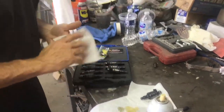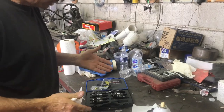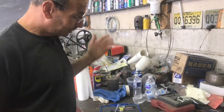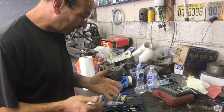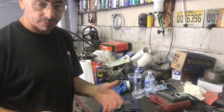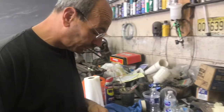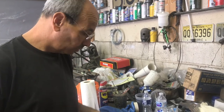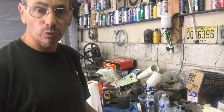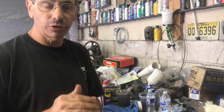That's basically the process of cleaning them and keeping them maintained. The supplier recommends doing this if you're not going to run the car for more than a couple of weeks. The car's already been down two weeks and it's probably going to be down for another week and a half, so I'm not going to take any chances. Once we put them shutoff valves in there it's a half hour job, and for injectors that are a couple of grand you want to make sure you're taking care of them. We're going to hopefully get to the track next week and put all the stuff back together — basically reverse of what we're doing. We're going to order up those valves and do another little video. The next video will be on the Falcon.